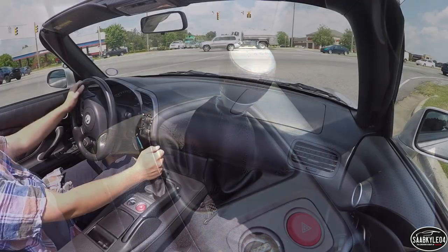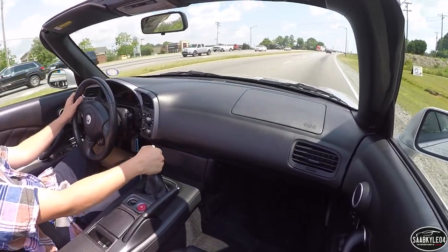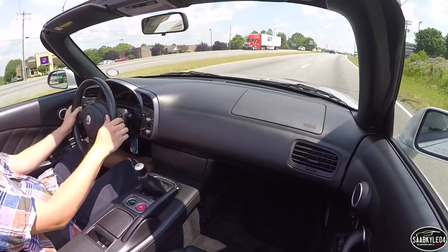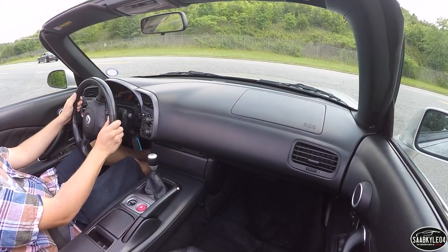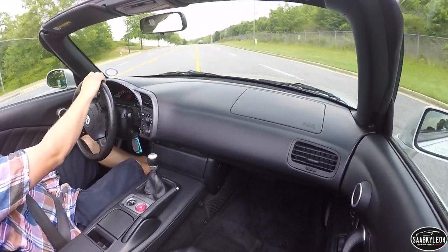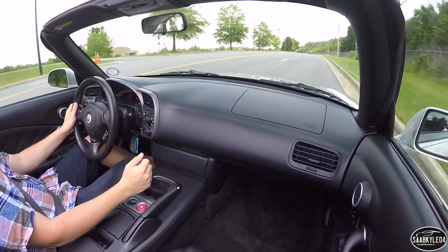I've always thought Honda had an excellent 6-speed, especially in the Civic Si's I've driven. The short throw shifter feels great in your hand, the clutch pedal is perfectly weighted and has relatively short travel. It's also very smooth thanks to double cone synchronizers on 1st, 3rd, and 4th gears, and triple cone synchronizers on 2nd gear. Along with a low mass flywheel and a high performance clutch, the manual is quick to engage and respond.